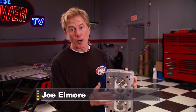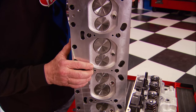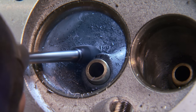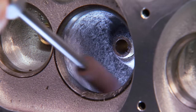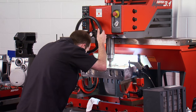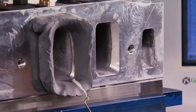If you saw our show a couple weeks ago, you caught a glimpse of these Edelbrock Performer RPM heads for the 455. They've got combustion chambers that spec out at 77 cc's, with valves at 2.19 and 1.88. These things make really good power right out of the box, but as we saw at Mandela's place, there's always room for improvement. They roughed out the combustion chamber valve pockets and polished them to a smooth finish. These heads are ready to use right out of the box, but a three-angle valve job is assurance the valves will seat well and flow freely on the flow bench, as well as when installed on the motor.